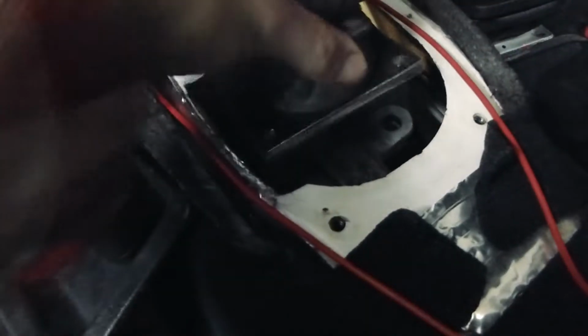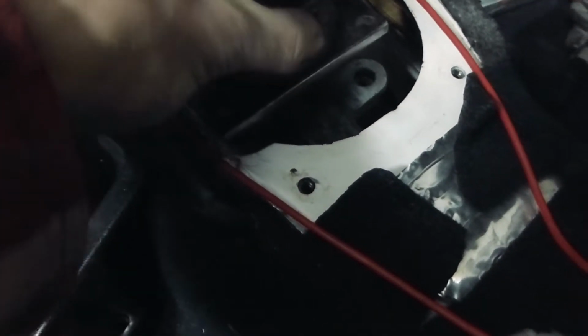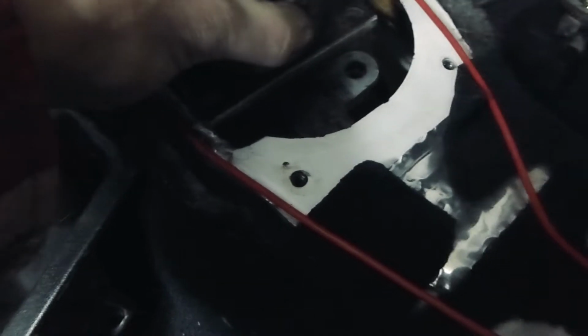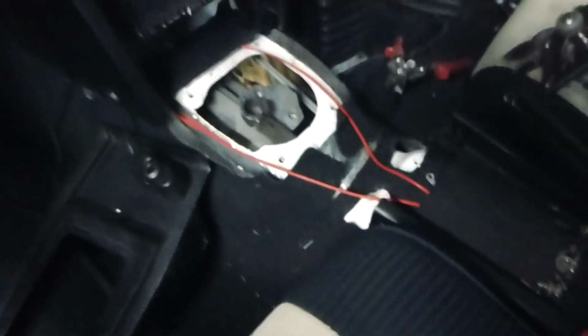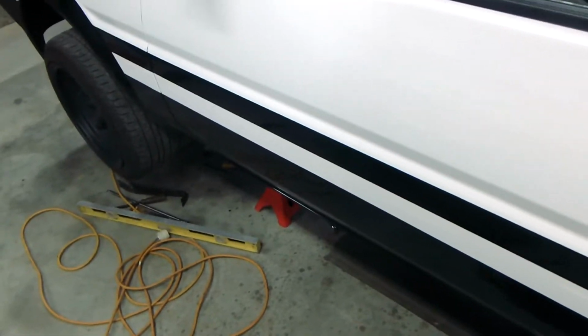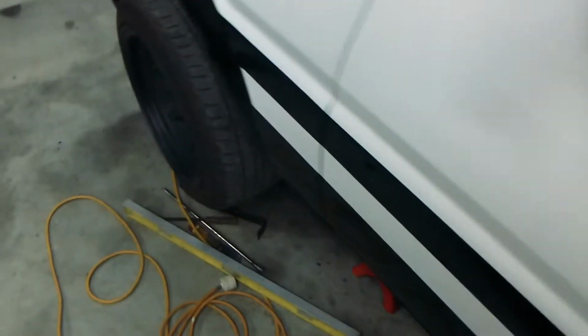So what I'm thinking is not actually bolts right through because it might get in the way, so I make a stand that basically bolts down to that and welds onto it. That way we have a shifter. It comes perfectly out in the middle, so it should fit all the plastics and surrounds and rubber boot fine. We'll be shifting away. And then after that it's hook up the clutch, which also looks like the standard one and standard line will reach, which is handy.